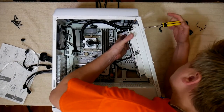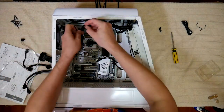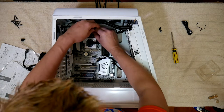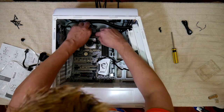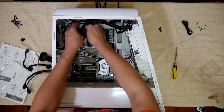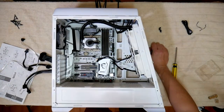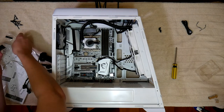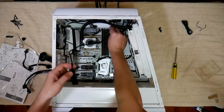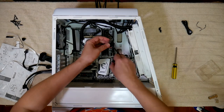The CPU pump wires plug into the motherboard CPU header. I had some trouble getting the CPU pump light LED to come on, and I figured out that the cause was that in the board's BIOS, my CPU fan was on the default setting of PWM or power managed. Once I took it off that and put it on normal, it came right on — so it needs to have full juice going to the pump. The radiator tubing is a slightly flexible rubber with a weave cover. It feels sturdy and should last a long time as long as you don't pull on it hard. It resists kinking also, which is nice. This board has a pump header, which I'll be plugging the pump fan triangle header into. If your motherboard doesn't have this, a case fan header should work just fine — even better if you can monitor the speed through the BIOS.